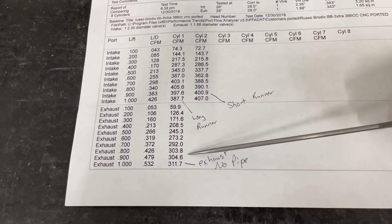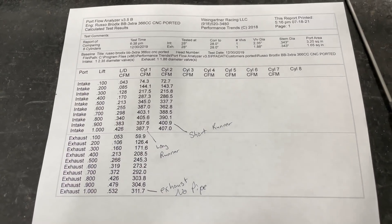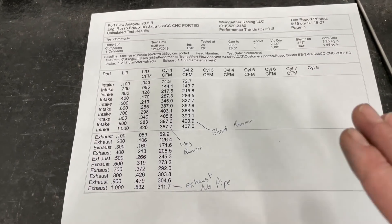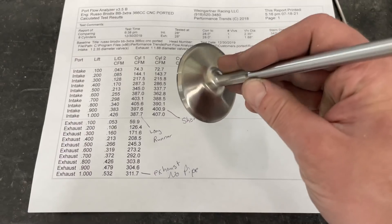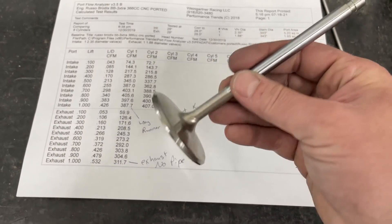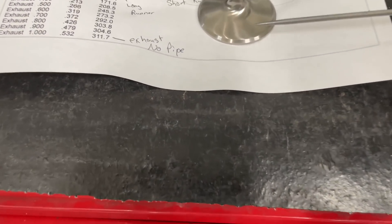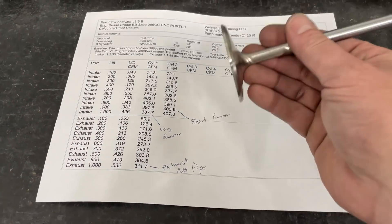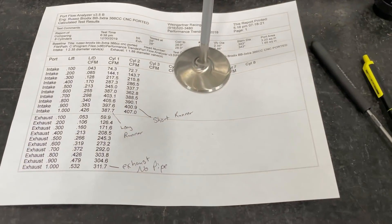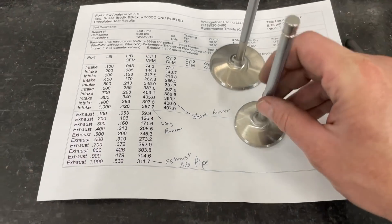The exhaust flow is really strong - really, really strong - and this is with no exhaust pipe. Now before I go further, I want to show you what I flowed with. These are Ferrea Comp Plus valves - more expensive than Brodix valves, they weigh a little bit less, and they typically flow more. I did not put a back cut on them because the Ferrea Comp Plus valve has this radius already cast into it that's almost like a back cut. This will probably outflow the Brodix valve anyway. The exhaust valve has more tulip in its design than the Brodix one. So just know these valves are different from what you'd get from Brodix.